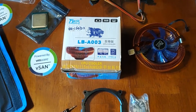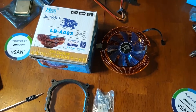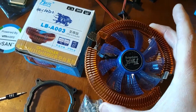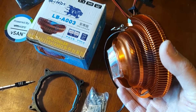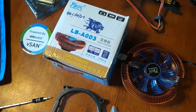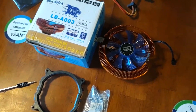Speaking of cooling, I wanted to talk about this cooler I bought. This was the first cooler I bought — a $10 cooler. It kind of has a Zalman look to it and would have fit really well, but the problem is the seller took about two months to ship it to me. It uses a plastic ring that snaps on top with little clips. The problem is it probably weighs a couple ounces — it's super lightweight. This cooler never would have worked for the Xeon processors; it would overheat them. Though they say it's built for 2011 processors, I would highly not recommend this. They call it a hydrocool cooler, but when it came in, though they told me it was supported for 100 watts, the box clearly shows 75 watts. Not a good cooler — do not go with it at all.